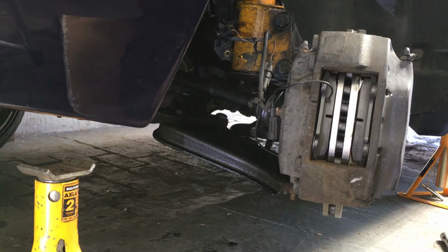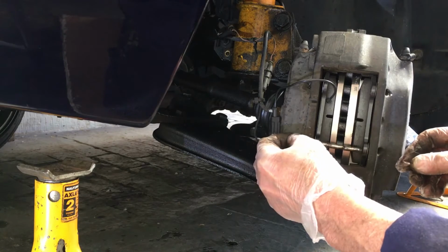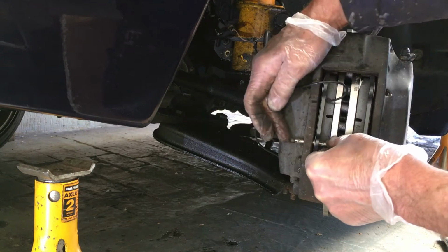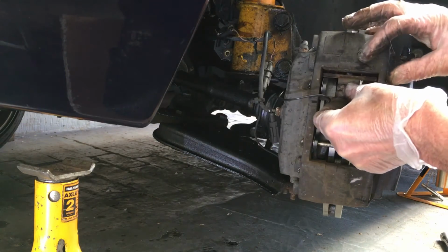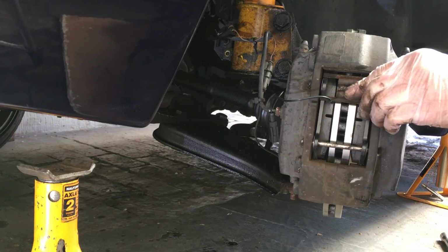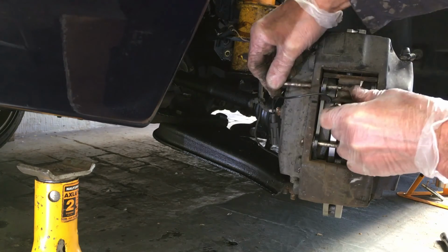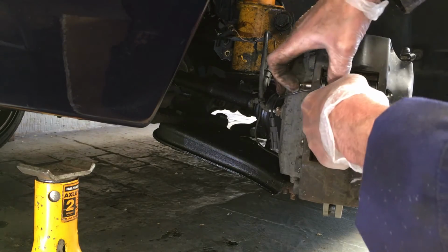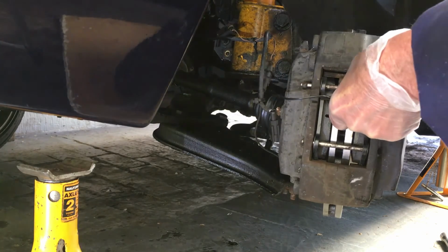Okay, so we can put our bottom pad securing pin in to get them lined up. It's only held in by this friction collar there, which is fine, that's good enough. So this is the top clip, which needs to go in that position there. There's a bit of a spring on that. That can be a bit difficult to get in. If I can find the pin, there it is. Right, that can be a bit difficult to get past there. Press that in, come on baby, okay. So just push that in and give that a bit of a tap.